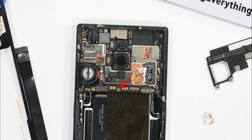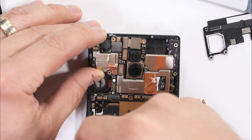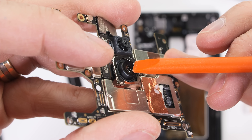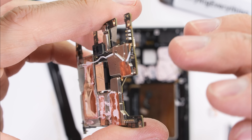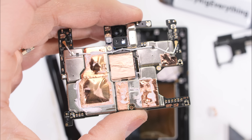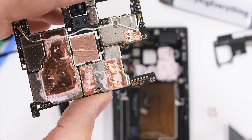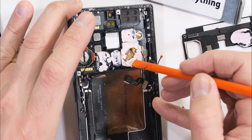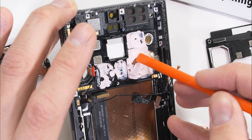I'll remove the one Phillips head screw and one standoff screw from the main motherboard, along with a bunch of signal wires. The motherboard has our camera still plugged in — we have our 50-megapixel main sensor with no OIS, and the 8-megapixel ultra wide up top, also with no OIS. On the back of the motherboard is where we find the rest of the 11-layer heat dissipation system. The main processor uses copious amounts of thermal paste and a few copper layers to transfer heat to the thermal paste on the frame. There is also a massive copper vapor chamber which helps all the heat escape out through the front of the phone through the 120Hz OLED display.